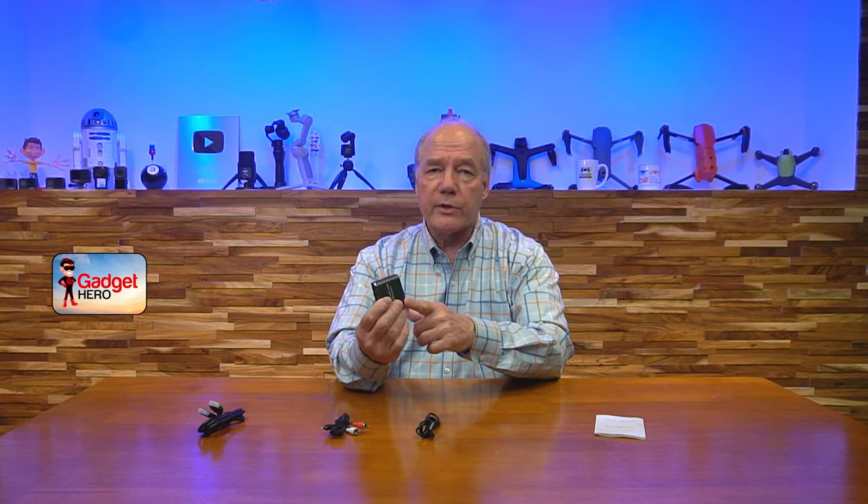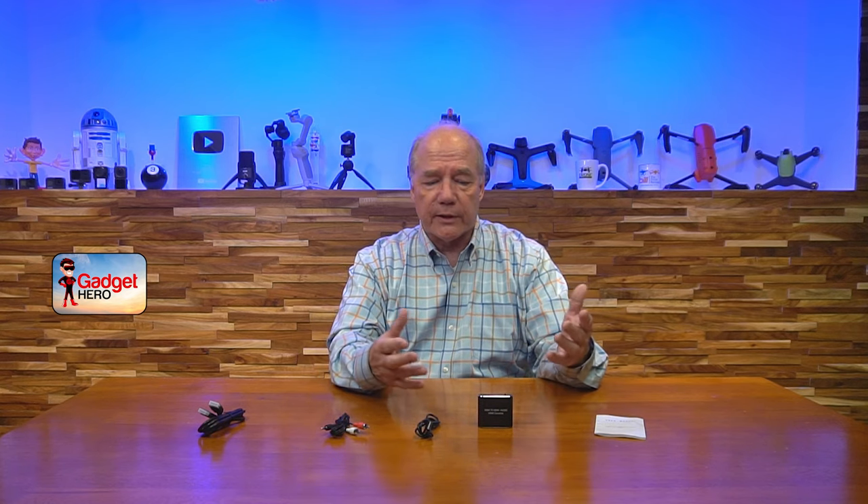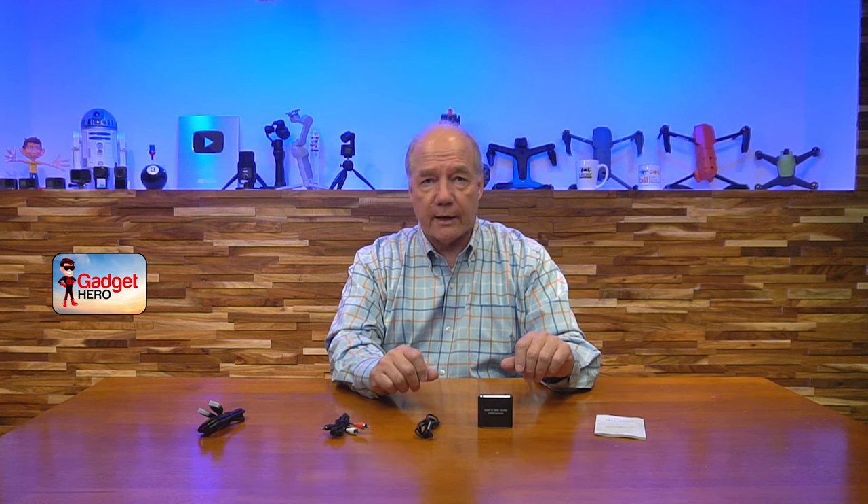You essentially plug this in-line with the HDMI signal — your source plugs in on one side and your monitor on the other. It actively watches the HDMI media stream, extracts the audio component, and converts it to either an analog signal or a digital signal. If you've got a soundbar with an SPDIF or coaxial optical connection, you can pass it through digitally. If you have an older stereo that only accepts analog inputs, you can pass it there too. It's a Swiss army knife of connections, and the best part is both outputs are active at the same time.